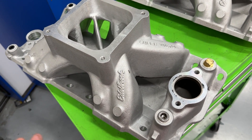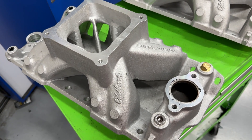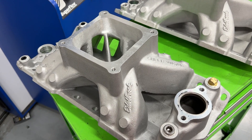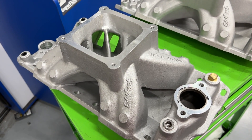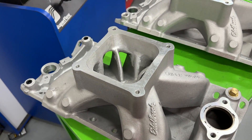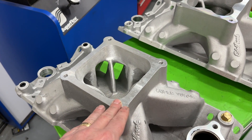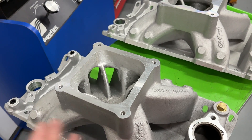The engine itself used to test this was a 406 small block Chevy, 11.2 compression ratio, Pro Max Project X 215cc heads completely stock, solid roller camshaft, 260-270 duration, 685 lift on both sides, 108 lobe separation that came from Erson. It had a 1050 Dominator on top from Holley, just an out-of-the-box unit that had to be jetted down a little bit. It also had a one-inch tapered four-hole spacer, and both the before and after tests had that spacer.